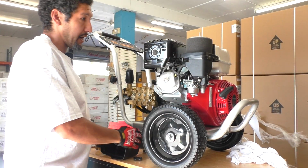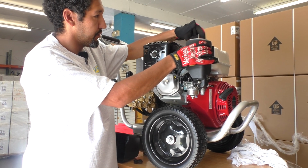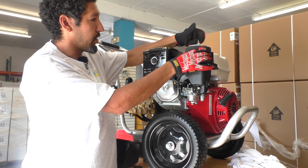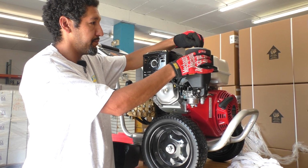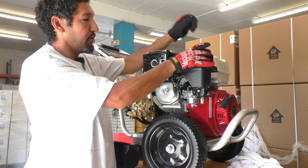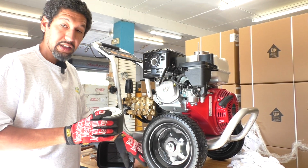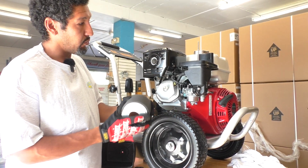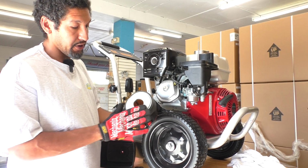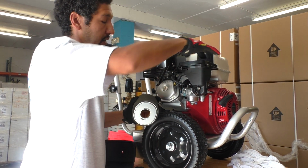I'm going to pull this air box off, and I'm going to get here to my air filter. I want to pull off my air filter really quickly and inspect it. If a unit was flipped over on its side or bounced around violently a little too much during shipping, we might find some oil residue here, maybe even here where the filter was sitting.